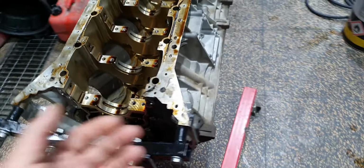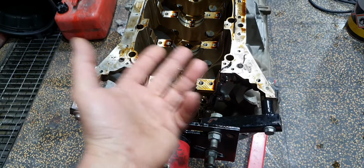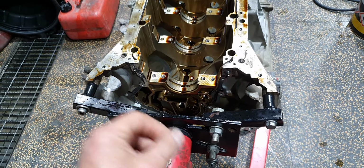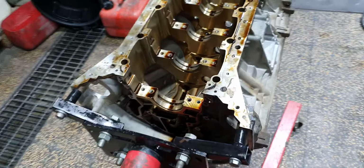Now the cylinder head, if the guides are okay, the seats are okay, the valves are okay, and they don't have any runout, they don't have any wear, you just slap the valves in, everybody happy, new valve seals, and you're okay. You take care of the imperfections on the casting, like I said all the time.